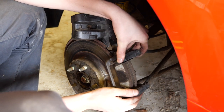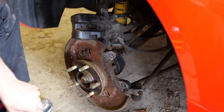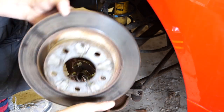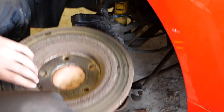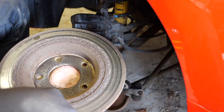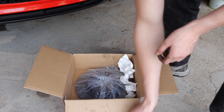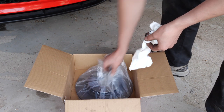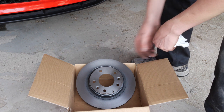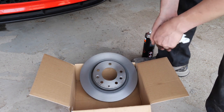The carrier should just slide off and allow us to take the disc off. The disc is loose on both sides at the rear — even though there's a hole to screw it in, there's no corresponding hole on the hub. You can see the rear disc is quite corroded — I've seen this before where the outside face looks fine but the inside is corroded. It's 13 years old and definitely never been changed. Putting on shiny new Brembos — not genuine Mazda discs as those are really expensive. These are decent quality Brembos, not slotted or drilled. Most people say standard discs are fine with standard calipers; the pads are the most important thing.